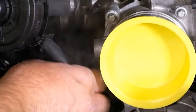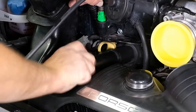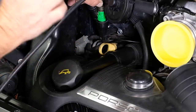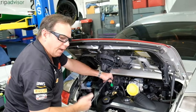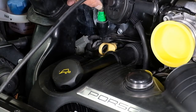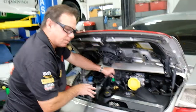There are other areas connected to the intake system, and like I said, false air. In the crankcase, we can also smoke the crankcase section. Right now I'm smoking the intake, but we can smoke the crankcase too. Items that affect that atmosphere are the oil filler tube, the AOS, the AOS drain hose or boot, and the accordion boot. In the older cars, the dipstick where it connects to its pipe or where that pipe connects to the engine — anything that's part of the intake or breather system can affect that atmosphere.